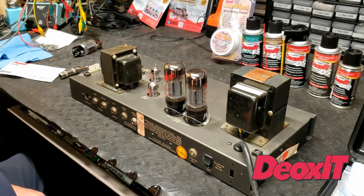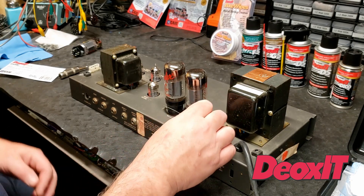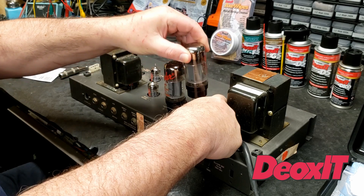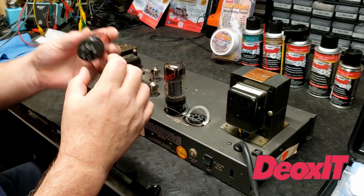This is a typical project that you might find in our shop. There are lots of different amplifiers from Fender, Marshall, etc. But the manner in which you remove the tubes for servicing is pretty typical. A lot of them have the bear trap or another spring-loaded piece of metal which you have to pinch open. When you want to get the tube out, you want to make a circular motion and pull up gently, and then it will come out and you can examine the pins.